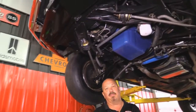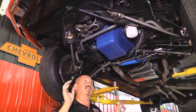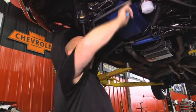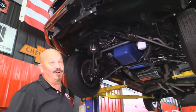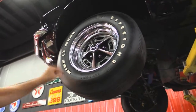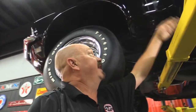These are original Ford Magnum 500 wheels. Nicely painted bottom side of the motor. This is a period correct 428 block — it was taken apart and it's got the original Super Cobra Jet crank. They drilled the crank and filled it with Mallory and balanced it internally, so it does have the Super Cobra Jet crank, just no hatchet. We've got all the paperwork on the build of the motor. New bushings on the radius arms. Front core support looks good. This is just one beautiful, off-the-hook R-Code sports roof. We've got those original Magnum 500 wheels with wide oval Firestones — brand spanking new from Coker — just like it came from the factory, and boy do they make the car really hop. Great looking paint on the lower front fender.